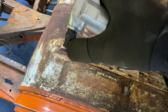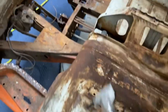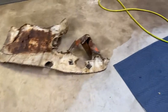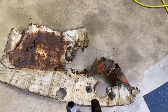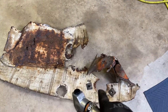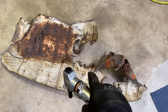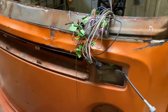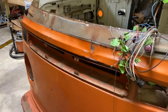Under power you're able to direct the cut you want to replicate or what to cut out. That's what I used to fold this section up — you can see those sharp lines I cut there, which was just to gain access to busting the rest of the welds to the frame and chassis rails with the air chisel. The nibbler is what I used along this top line here where I cut the windshield repair section that I'm going to be welding in.